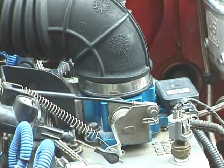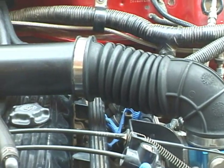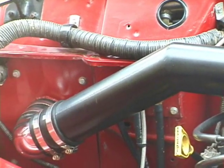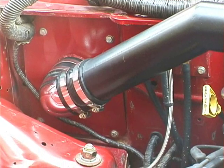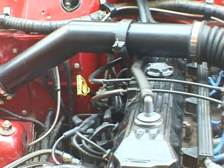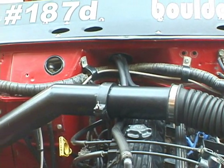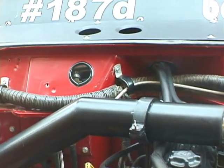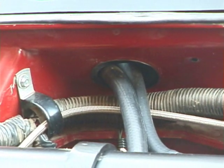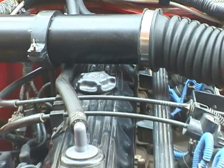The boot for the air intake system comes off the throttle body and runs across the top of the valve cover on a support bracket bolted to the valve cover. It dives down into a bulkhead unit where the original fan blower was. On the right you can see three breather hoses from the front axle, transmission, and transfer case — they go through the firewall. Both the air cleaner and all breather valves are inside at the passenger footwell. In the cowl area there's the PCV and CCV catch can, with hoses running out and down the valve cover.